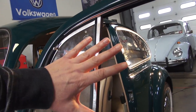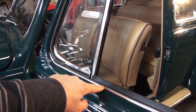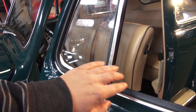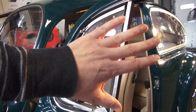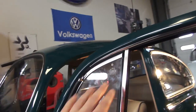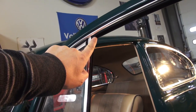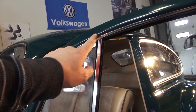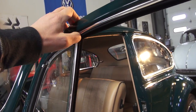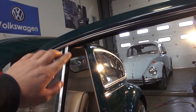You're going to insert the vent on a tilt, with the stem going into the door — there's an opening where the vent stem goes in. Once you poke that in, you can start bringing the vent window this way and bang it into place. Make sure the vent is inside the door track, because a lot of times people scratch the door because the vent is not in the track — it ends up on either the outside or inside.